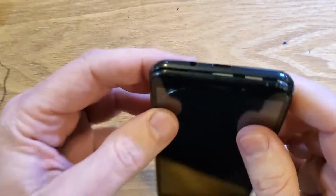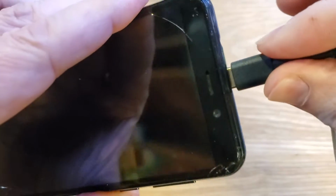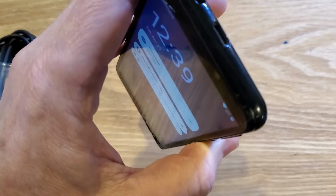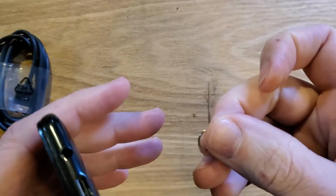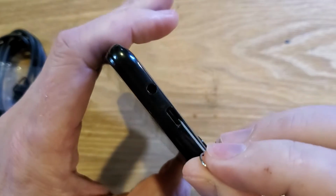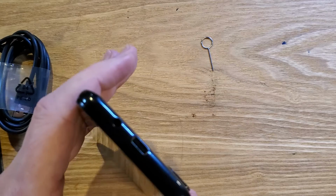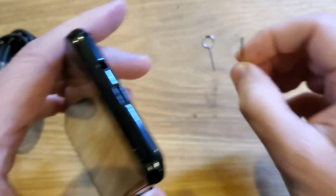All right, and moving on, let's go to the next one, which is your charging port. Make sure that your charging port is clear and there's no grime or dust or buildup, and that when you actually use your charger, it plugs in all the way cleanly. There's a clean, crisp click. And if it's blocked with a little bit of gunk, you can get an old paintbrush and try to get some of that gunk out. And if that doesn't work, you can use the little tiny SIM tool. That SIM tool is small enough to help get some of that grime. Be very, very gentle and delicate to pull the grime out of the way. And if you don't have that little tiny SIM tool, a smaller sewing needle. This one's kind of big, but you can get some of the grime and buildup out of the charging port to make sure it's taking a charge.